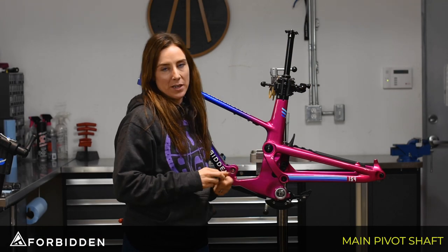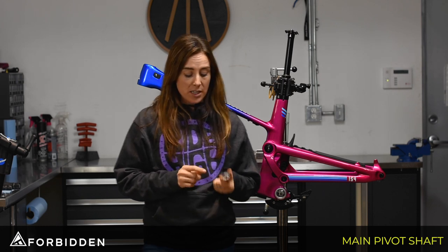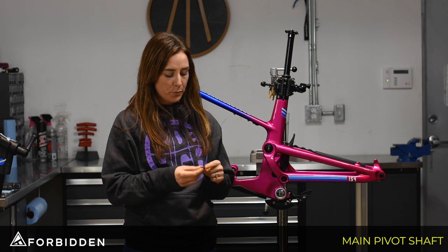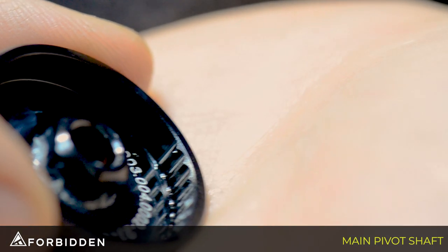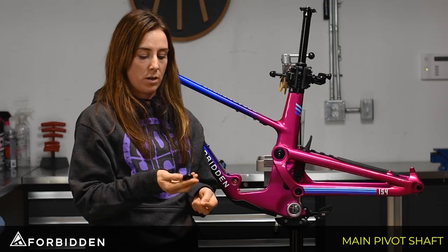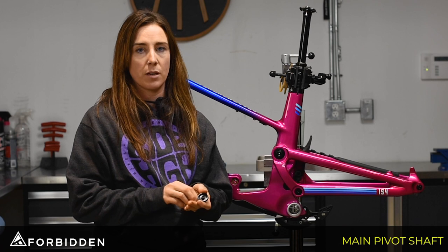As you may have realized, a 24mm wrench and a 10mm allen key aren't really tools that you'll be carrying on your ride. That's why on this locking cover we have a keyed center and teeth that bite into the nut — so if you're riding with your cover on, it's pretty much impossible that your main pivot is going to come loose.